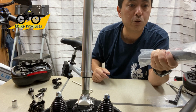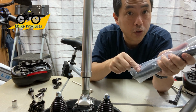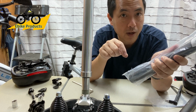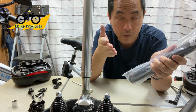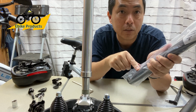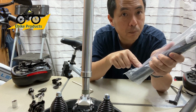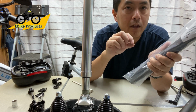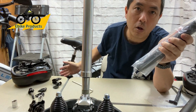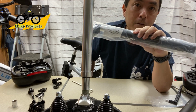Again, these posts are 31.6 millimeter. So if you have a bike that actually fits that, if you're not sure what size post your bike has, if you go to electricbikereview.com and you have an electric bike and they've done a review on it, in the description they actually say what the seat post diameter is on a lot of their descriptions. So you can look on there. As long as it's 31.6, it should fit. I am not guaranteeing it'll fit unless you have a Lectric XP. I know for sure 100% it fits all Lectric XPs. That's why I got these, because it is one of the highest volume selling bikes in the US.